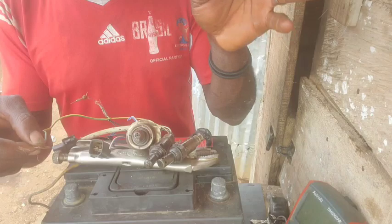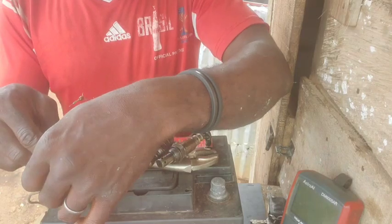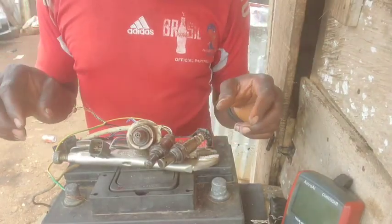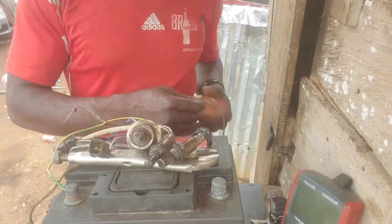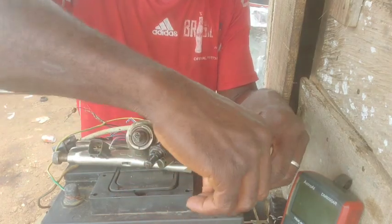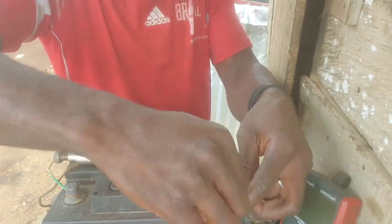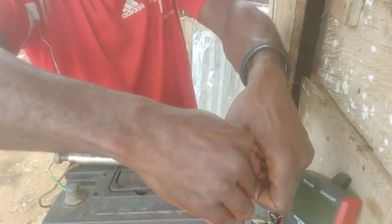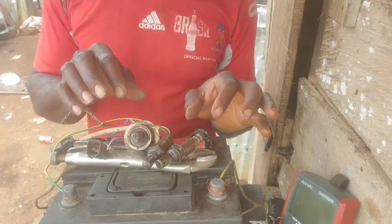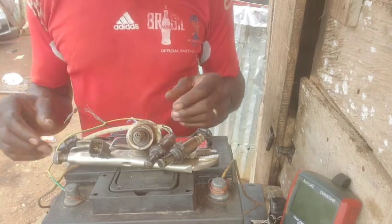Aside from using a multimeter to check resistance, this battery heat-up test is the ultimate alternative test to know if an O2 sensor is bad. It will be easier and cheaper to replace it rather than bypass it and create more problems — catalytic converter failure, engine failure, and other issues. I've sprayed some oil on the sensor tips so we can visually see which one heats up first. A good sensor should heat up red hot within 30 seconds.